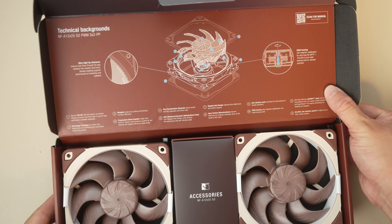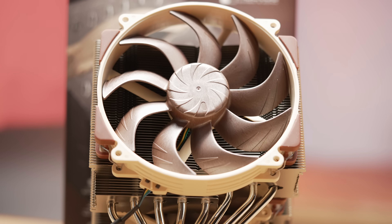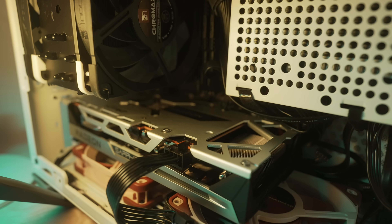This is more work than is necessary, because you may not actually have that beat frequency occurring in your system, and you may not even notice it to begin with. So if you are sensitive to that, it's something to consider. Another application is replacing fans on an air cooler. The 140mm G2s worked very well on the D15 G2s and even as replacements on the old D15. So as long as you don't need rounded corners for your tower cooler, these will work very well on any 120mm tower or top-down cooler, and you can get the PP set if you're doing a push-pull setup. If you have a Noctua U12A, you have the G1s already — so unless you want the PP set for noise reasons, I don't think most users need to swap out G1s for G2s. Whether there's enough performance difference to justify the cost and hassle of switching everything out is a consideration, because the G1s are still very incredible fans.